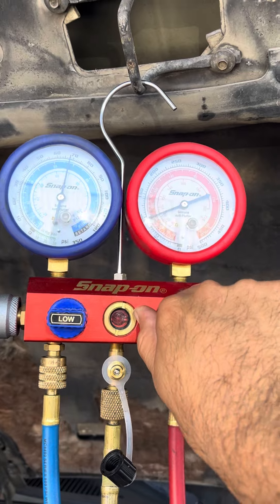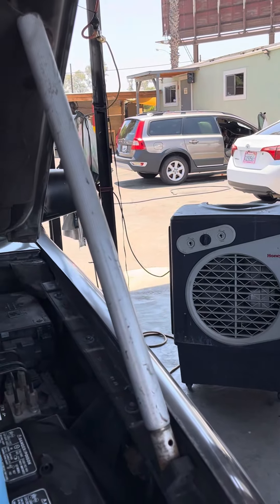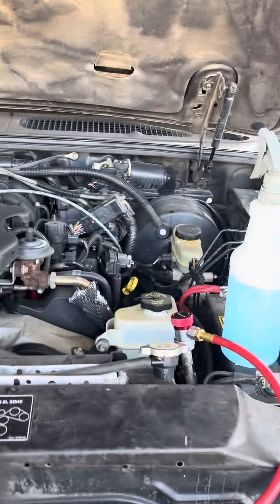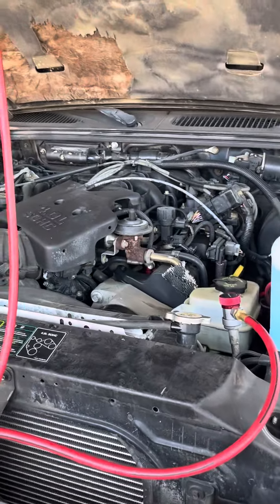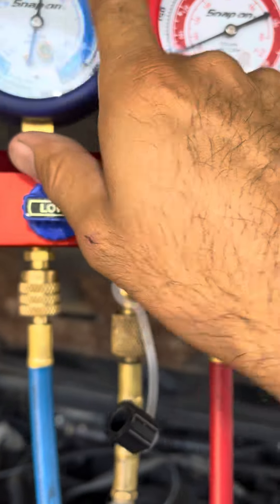Watch it — 10. Do me a small favor: turn on the truck and turn on the compressor, please. Turn on the compressor just for about five to ten seconds; as soon as you turn on the compressor I'll tell you to shut it off. We wanted to turn it on and activate the clutch, but it also has to compress — just because the clutch is working doesn't mean it has good compression.